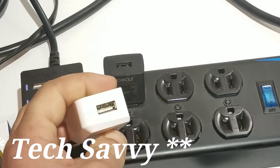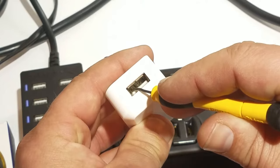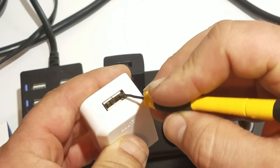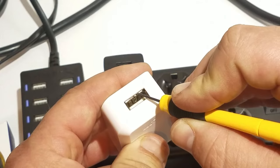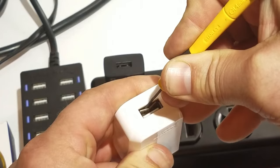If you're tech savvy, here's what you can do. Here's a close-up of the inside of a USB charger — this is the female end. Up here, you can see the metal bracket is pushed up, which is what makes things loose when you stick them in. To tighten it up, you can take a small flat head screwdriver — like a jeweler's screwdriver — go in at the top above the bracket, apply pressure, and pull it down. Do it on the other side too, and now you've got it looking tighter.